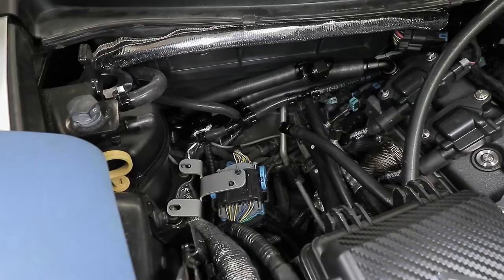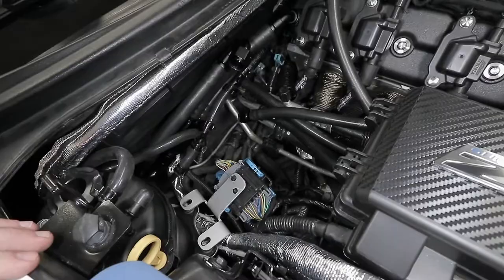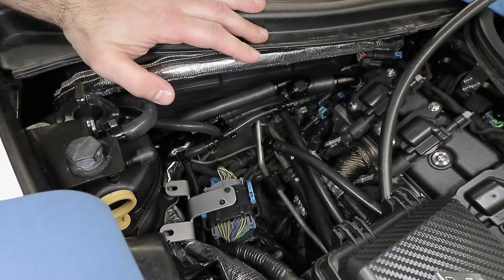I'm using Parker 801 hose — heavy duty, kink-free — for pretty much everything on this car. As you can see, nothing here is stock. I removed the stock hard lines because those lines that attach to the dry sump are not compatible with the CPR tank. There's an interference issue — the CPR tank butts right up against the space where those lines route.